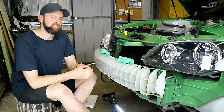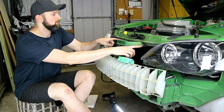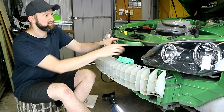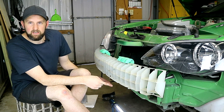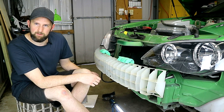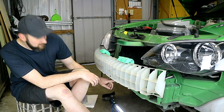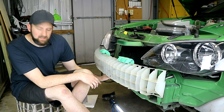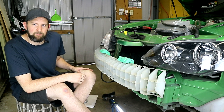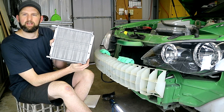Part of what I really like about this kit is that the mount bolts up using factory holes and factory studs. The top bolts into two blank holes up here, with a provision to move a wiring connector forward on the bracket, so it bolts up in front of your bonnet lever. For the bottom mounts, they actually use your factory power steering studs. There's a small power steering cooler line looped around the front — undo the nuts on the end of the studs, pull your power steering cooler off, slip the brackets in behind it, and put your power steering cooler straight back on and tighten it down. Leave everything loose for now and we can start putting the new cooler on.